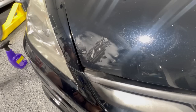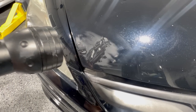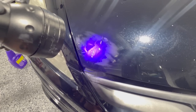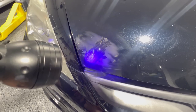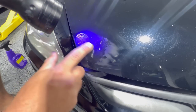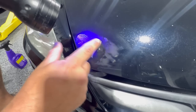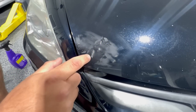From this point, you'll need an inexpensive UV light. Everything used in this video will be in the description. This will cure the UV putty. Keep in mind, it will never cure unless it has this flashlight or is exposed to the sun's rays for at least 3 minutes straight. So in just seconds, it's completely cured and it's ready for some sanding. You can feel here, it's not perfectly smooth and that's 100% okay. In the following steps, you'll see how we smooth it out as much as we can.